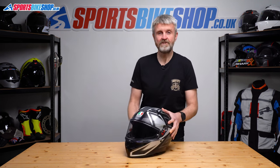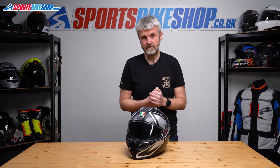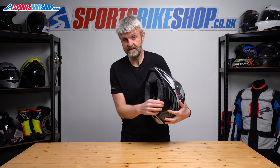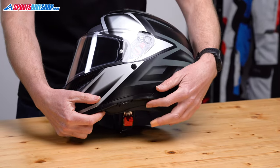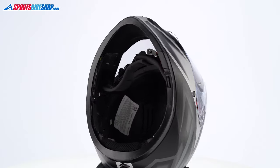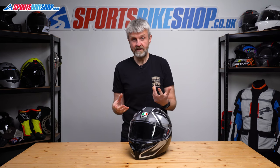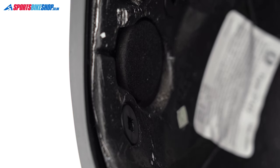There's no dedicated intercom for this helmet, with AGV saying it suits generic communication systems. There are a couple of issues though. Firstly, the trim at the base of the helmet is a little bit fat to get a clamp mount around it, so you'll probably have to use a self-adhesive pad to stick it to the shell. I did that with a Sena 20S Evo intercom, and it sticks out a little bit below the base, which then made it trickier to operate the sun visor switch. I think this helmet would be best with a sleeker intercom that doesn't extend below the bottom edge of the lid. The recesses inside for speakers are also pre-filled with padded boosters, which bring the speakers closer to your ears, but for some people they become too close and uncomfortable — which is exactly what happened for me. You'll need to carefully unstick those booster pads to give yourself a bit more room around the ears.